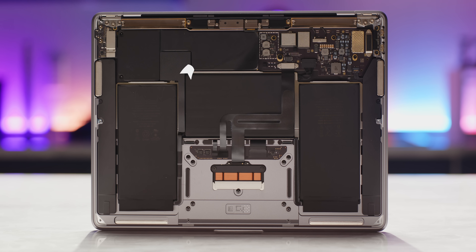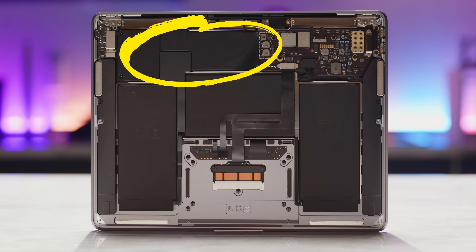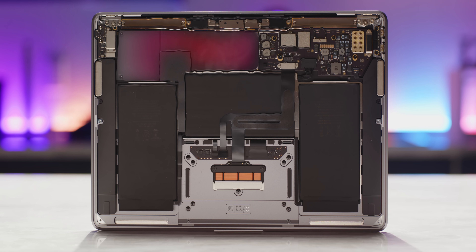Let's take a look at how it works. Here is the CPU and this over here is the heat sink. All the heat the CPU generates is transferred into this heat sink, and then the only place it can go is radiating around inside the chassis — except for one exception: it can actually waft out this gap at the back of the machine right here, but that ain't much. So it stands to reason that if we can improve the ability of the heat sink to get that heat out of the system, we could improve the performance of the CPU. But besides the low-hanging fruit of slapping a water block on it with tubes and a radiator hanging off of it, what can we do if we don't want to make permanent, unwieldy modifications?